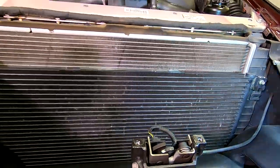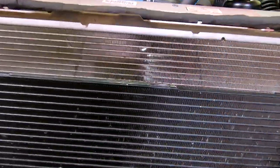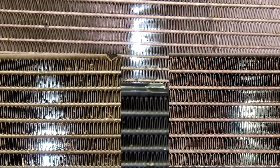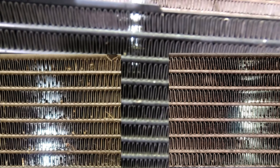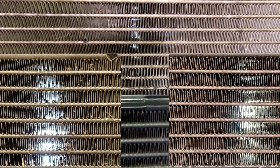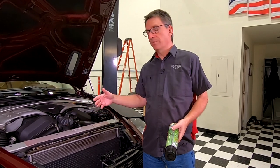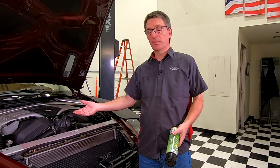Just for comparison, I'll shine a light from behind and we can see if the passageway is any cleaner. It's a little subjective, but I would say that a lot of the bug and dirt debris that was present in there before has washed its way out. You might have been able to do it just by hitting it with a hose, but I think it was worthwhile to use the cleaning agent as well. I wouldn't plan on doing this as a separate event — but say every five years or so when you're changing your engine coolant and have the under tray off, the only extra effort was taking off the slam panel, spending about 11 or 12 dollars on a can of cleaning solution, five or ten minutes with the brushes and vacuum, then spraying this on, waiting a few minutes, and hosing it off. It wasn't a real big deal.